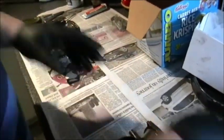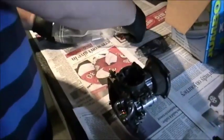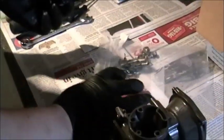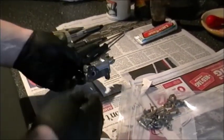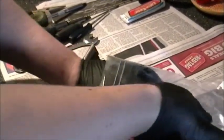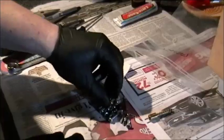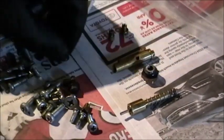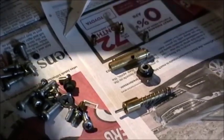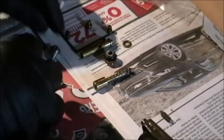Let's begin at the beginning. I'm going to take the front carburetor and pull out its parts. When we took these apart last night I saved all the gasket material and O-rings, so I'm not buying a kit — putting them together today and hopefully saving about $40 in unnecessary cost. If it doesn't work and we have a leak, we'll have to take them apart again, but thankfully we'll have a video to put it all back together. Some carbs are really easy — about two jets and maybe one tube. This carb had a lot of little parts, and we'll go into that.